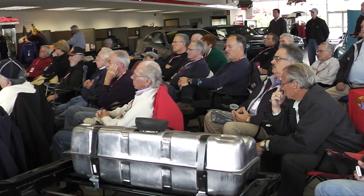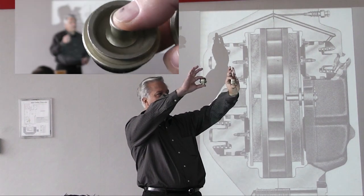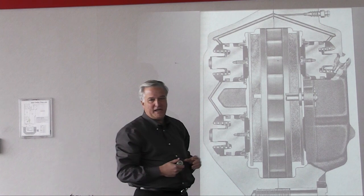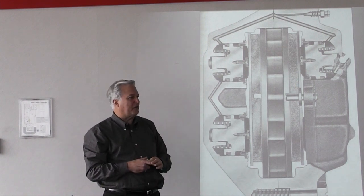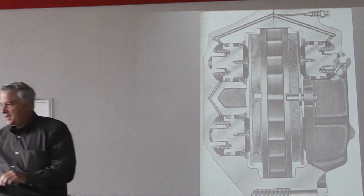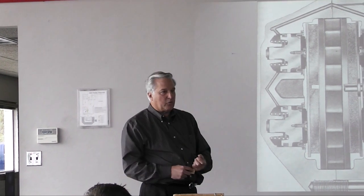Chevrolet saw a way to make money and came up with another piston — all the critical dimensions are the same. Here's the first gen and the second one. They basically eliminated the phenolic off the front and eliminated the guides — fewer machining operations. They also cheapened the castings. The early castings, if you talk to the guys that are racing, they always want to find those early generations because of the more magnetic structure in the iron — very stiff, very rigid.